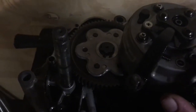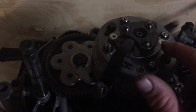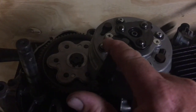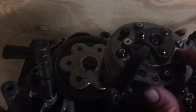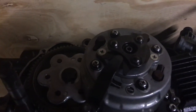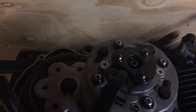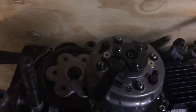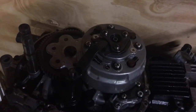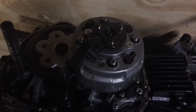If you were to take the clutch off, you would remove this, take this off, and take these two screws off here. Just be careful — they strip very easily. Underneath that cover there'll be a specialised nut which you can undo. If you're going to do that job, I would recommend buying that tool to remove that nut — it just makes it a lot easier.